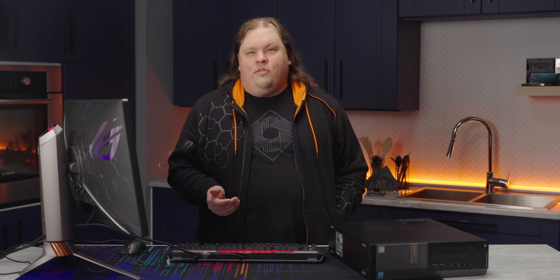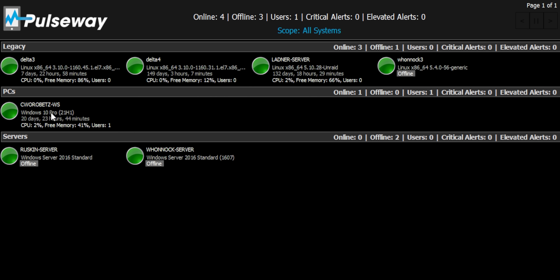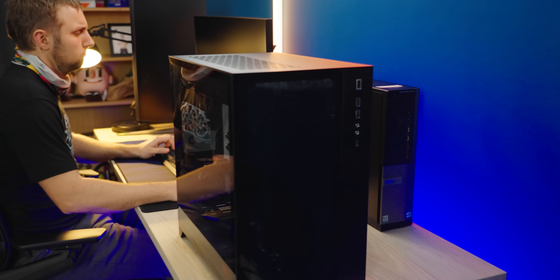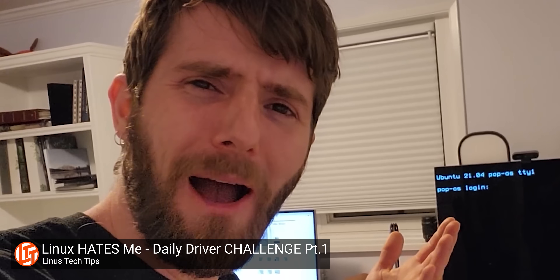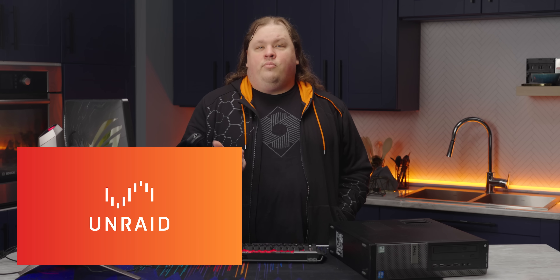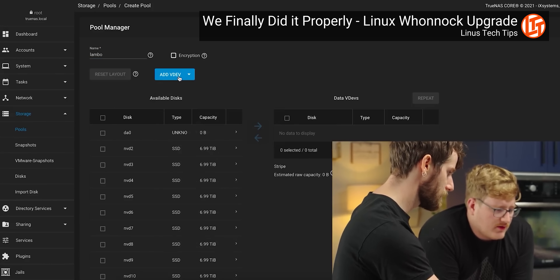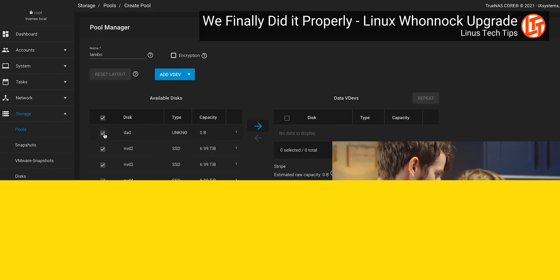With a basic file server set up, we can do a litany of cool things. We can point our Plex server to the storage folders and access the entire drive over the network. We can set up Windows Remote Desktop or use Pulseway's built-in remote desktop tool to control our server from anywhere without exposing our IP. We can also update Windows without logging into the system itself, even from your phone. And we're still running Windows — you don't have to learn anything new. If your main rig goes down, you have an easy-to-configure backup PC waiting in the wings. But if you want more control, or you don't have a Windows license, you could run a standalone Linux server. Unraid and Proxmox are also feature-rich options. For an intermediate user, we'd suggest TrueNAS Core, previously known as FreeNAS — it's free, easy to install, and has a decent UI. Let's kick it up by adding more storage and data redundancy.